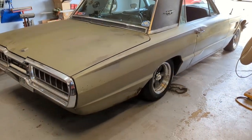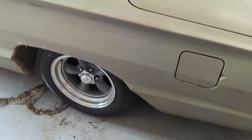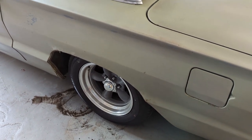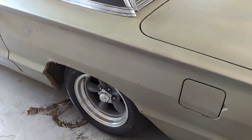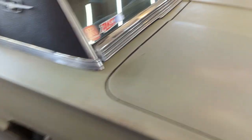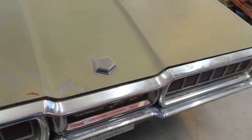She's back together, wheel's torqued. I adjusted the brakes up and torqued the wheels to 100 pounds. I'm going to take her for a test drive now. Hopefully that takes the sound out of the axle. If it didn't, I'll have to pull the center out - I have a spare center, so I'm not too concerned. But for now, this will do her.